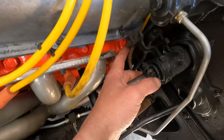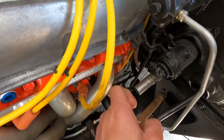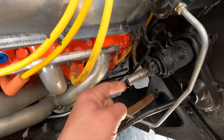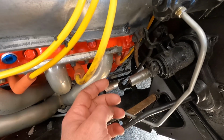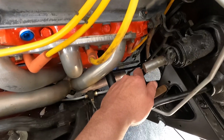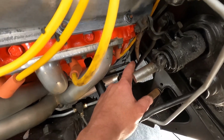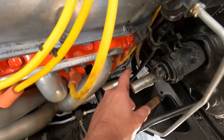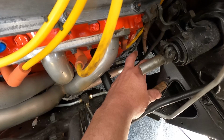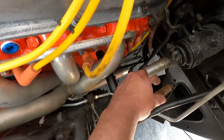Then this is your first and reverse rod. It had a big kink in it, and it was hitting the cylinder head, so I had to put it in the vise and straighten it up. And it's had some modifications done anyway, like it looks like it's been brazed together. And then I really need to check that clearance with the clutch arm. Well, the clutch arm has been modified, so it may actually hit, because the pedal feels strange. So I need to check that, because if that's hitting, then I've got problems.